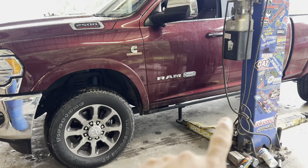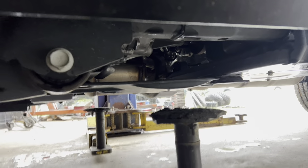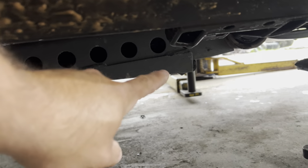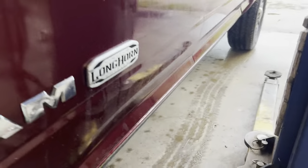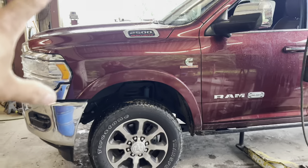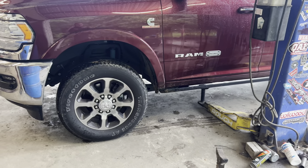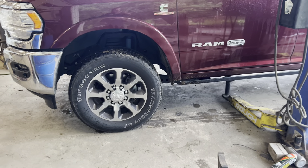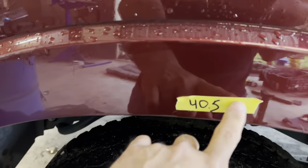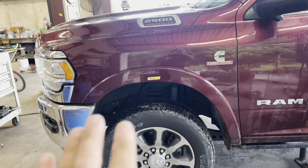This is how I always do them — I don't put the rear arms under the frame. I put one set of arms under the frame. Here's your track bar — I put them on the frame behind it because you want this track bar to be able to move. If I was just picking it up on the lift I'd put the bar here, but I need the suspension travel so I put it there. If you're doing this on the ground with jack stands you want to jack the truck up as high as you can and put your jack stands in the same spot so the rear end can droop and you can get the coils out. From the ground to the fender factory it's 40 and a half inches — the other side is about 40 and a quarter. I'm going to reference off the driver's side.